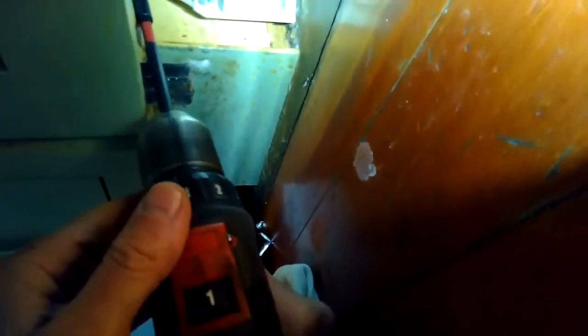So you've got to make sure again it's unplugged, and make sure that you've disconnected the water. We did take off the water line with a pair of pliers here in the front by turning lefty-loosey. You get that water line off. Usually you also have to take out a couple of screws that are holding the top of the dishwasher up into the cabinet — they're typically Phillips head screws.